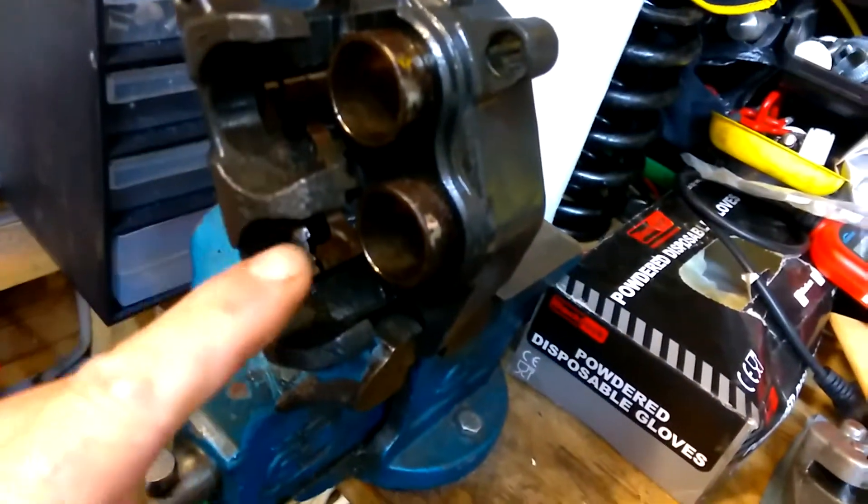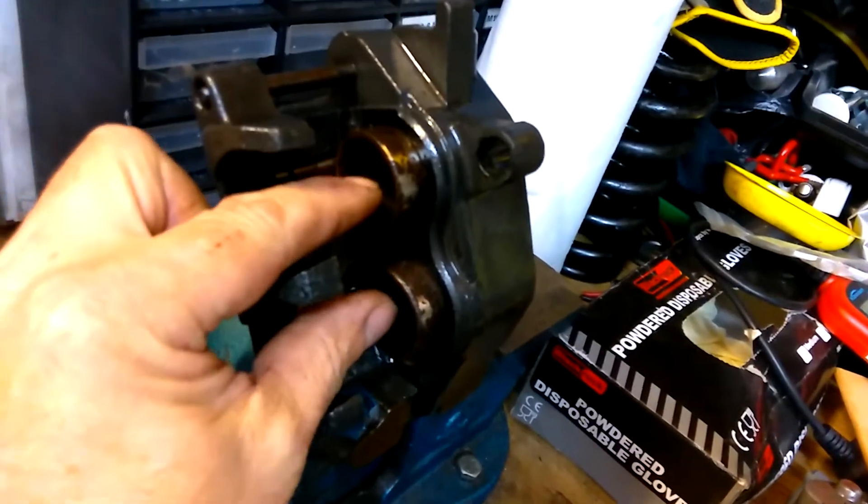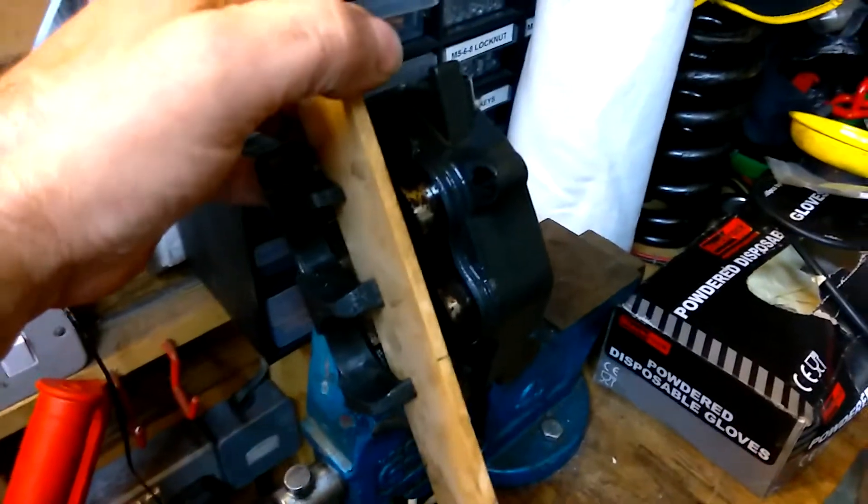These shapes are so you can get the pistons out. Trouble is, if I just put that on there now and give it a toot with the trigger, these pistons — if they do come — they're just going to go flying across the room. So what I like to do is literally just put a piece of wood in there, a little thin wafer of wood.